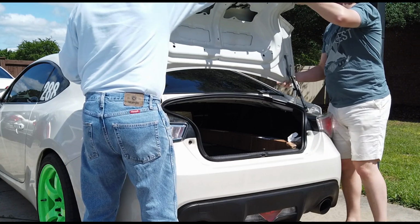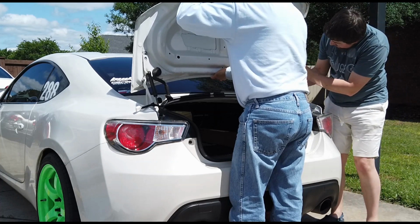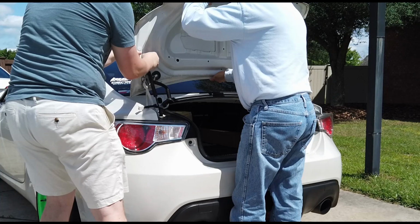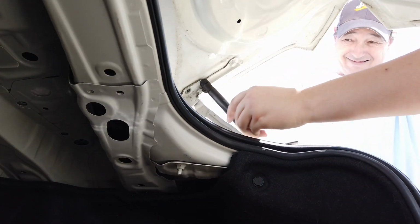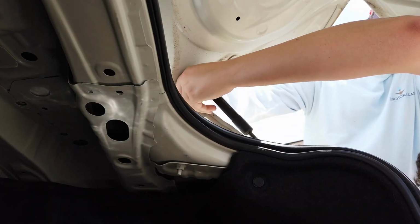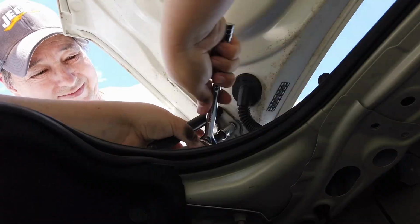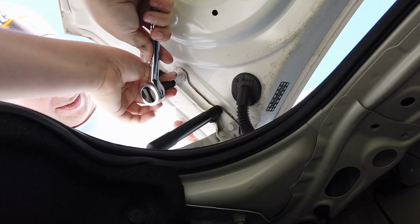Line it up with the hinges and thread the top 2 bolts, but do not tighten them yet. Hold the trunk halfway closed again and thread the bottom 2 bolts. You will need the top 2 bolts to be a little bit loose so that they have the flexibility to line up all 4 holes. Once all 4 bolts are threaded, ratchet them down tight.